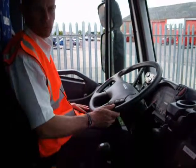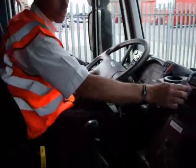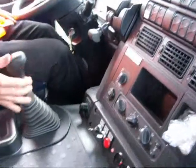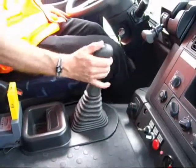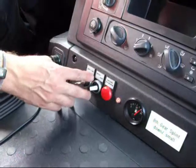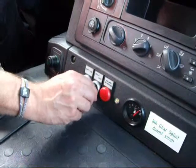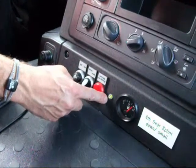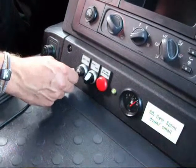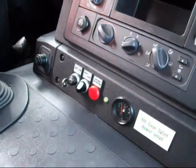To do this, turn the truck on and engage your clutch fully to the ground. Turn your pump off — you will see that come off on your dashboard. Disengage your gear to neutral and make sure you hit the neutral switch. Turn your suck back to drive on your middle switch. You will notice you are still on red — it goes back to green, which is your drive mode. Turn your key switch back to zero. You are now ready to drive off.